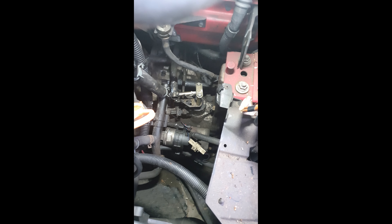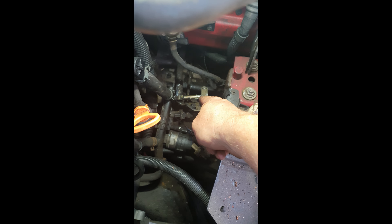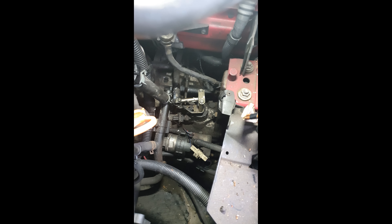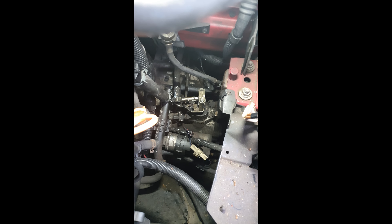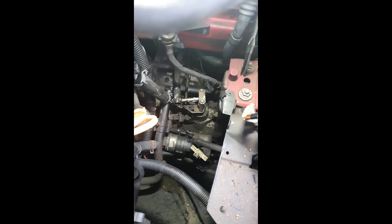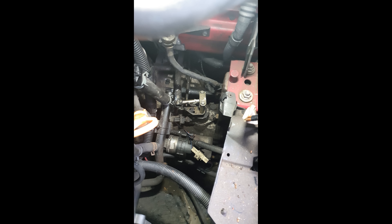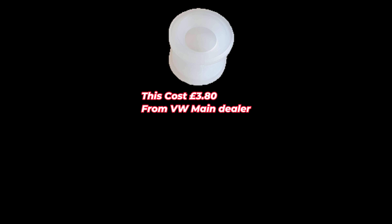So what I had to do — this is the way I done it. And it is a horrible job if you haven't got the right gear, it takes a lot of sussing out. So what I've done was I took this ball joint off here. These are known for going as well, the ball in here on the linkage. I've already replaced that once. This van's done 115,000 miles.